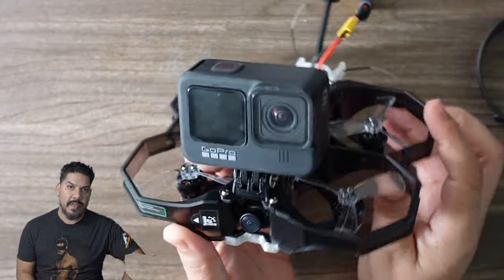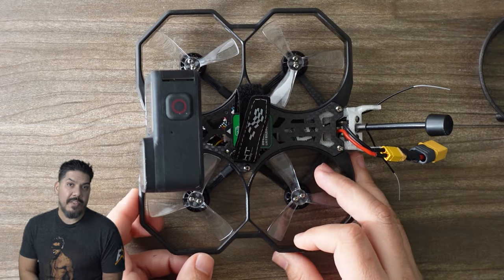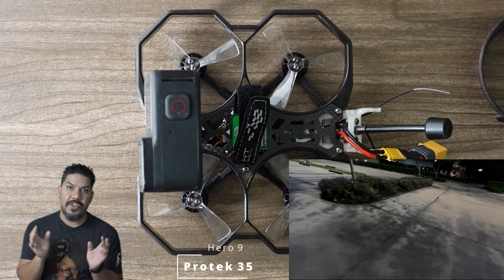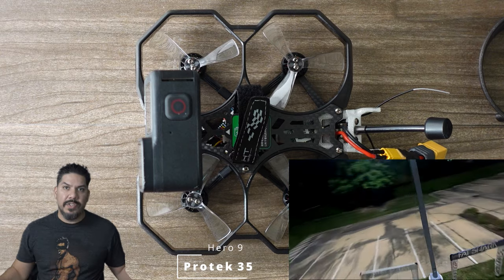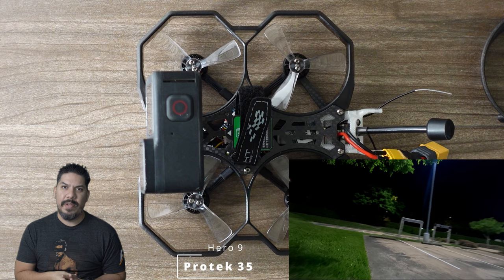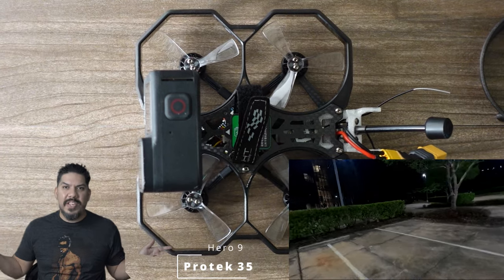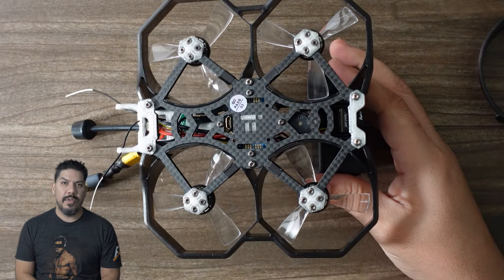The best ready-to-fly option on the market is the ProTek series — specifically the ProTek 3.5 and the ProTek 2.5. The ProTek 3.5 is very interesting because it uses a large 2203-size motor with three-and-a-half-inch props, giving you more thrust, more power, and more speed than the other options. That extra disc area lets you go faster. The downside is it's a little heavy and incredibly loud — every cinewhoop is louder than an average drone, but this one is louder by another magnitude. It sounds like 20 blenders surrounding your head, so you won't want to fly it inside or too close to people.